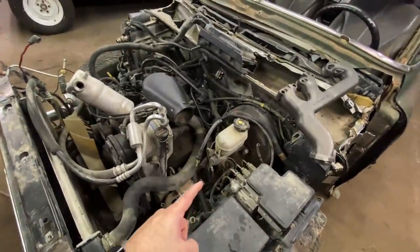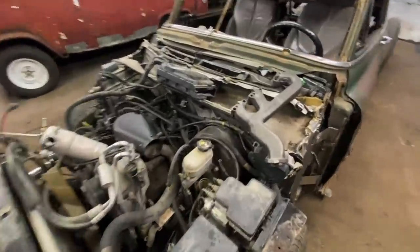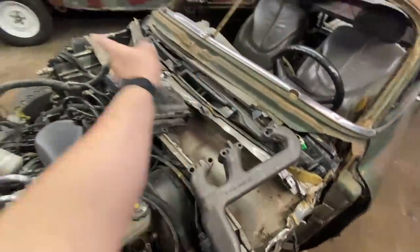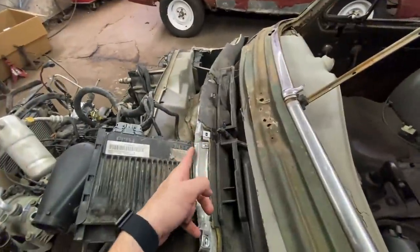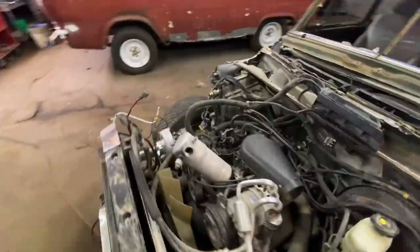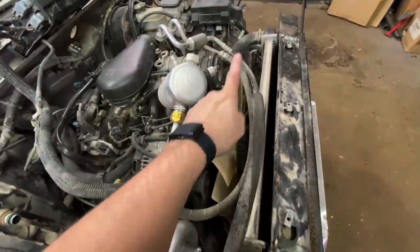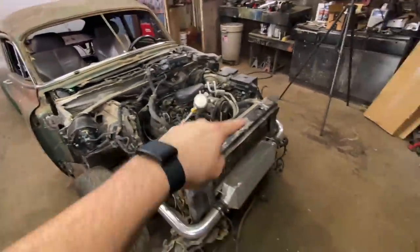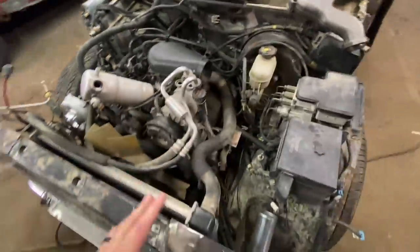So I can't run it that way. What I said in the video was my exhaust will just go back out the way it's supposed to, and I think people thought I meant only run it off one side. No — I just mean I can go out the back. What they'll do now is go up and connect to the other side of this pipe, because this actually does have some room to kick down. It can't go across like the kit wants it to, but it can go down that way.